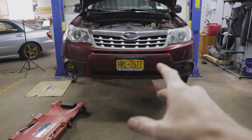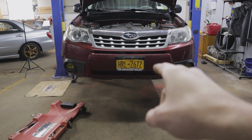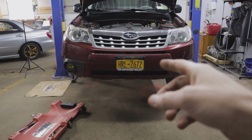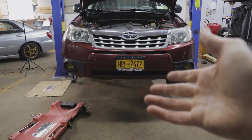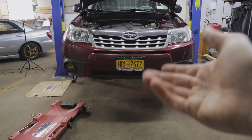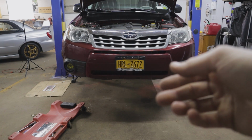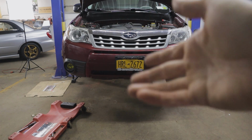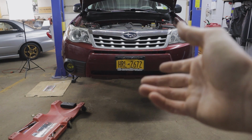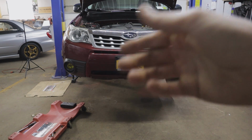I ended up having a problem. It turns out the plugs I was using had the typical coloring reversed. Typically in automotive wiring, red is gonna be your hot. If there is no red present, then yes, a lot of times black might be hot. Typically in automotive wiring, black is gonna be a ground. In this case, for whatever reason on these plugs, red was the ground, black was the hot.